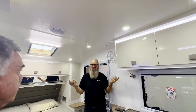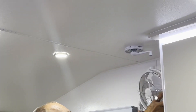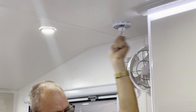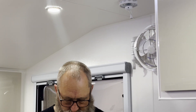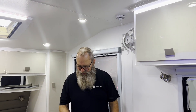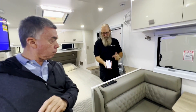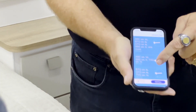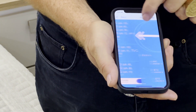For digital TV antenna reception, you've got to wind this antenna up using the arrows — only wind until it gets firm, don't over-crank it or you'll end up with the handle in your hand with springs everywhere. You want to find where the repeater stations are. Search for DTV on your app store — it shows all the repeater stations on a map. The closest is always at the top and it points to where it is. In this case it's Mount Pittha, so there are two arrows on the antenna: one is the base home position, the other you pull down and rotate around to point in that direction.